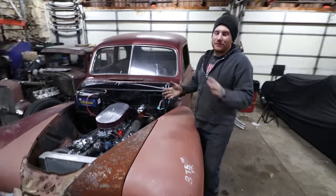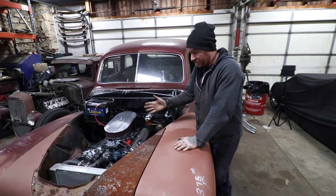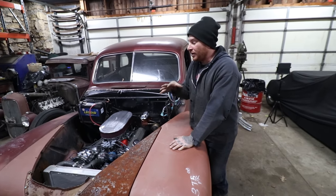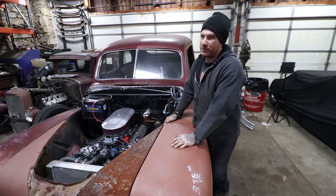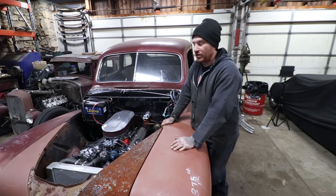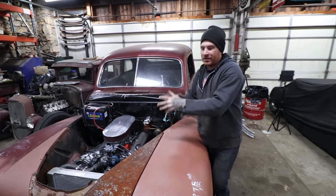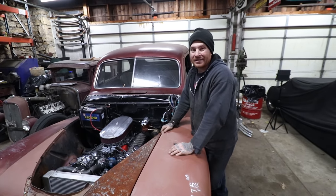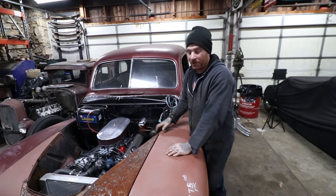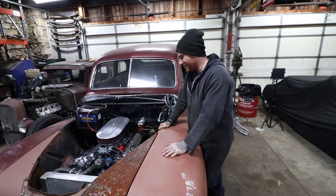Oh, we forgot to mention the biggest thing. After everybody was screaming at us — I mentioned it at the beginning — the distributor was a tooth off. That was the problem. It was too far advanced. I just thought, when the engine came to us all together, how could that be wrong? So this thing must have not been starting or running right way back when it was last driven. Steve went and took it out, turned it one tooth, put it back together, and everything instantly started lining up really nicely. Fired it up and it runs. Also, we were having trouble with it wanting to stall when taking it out of park and putting it in gear — that is magically fixed now too. Funny how the simple things fix everything.